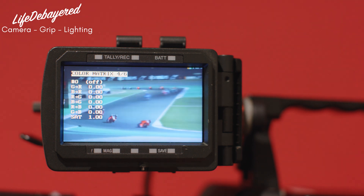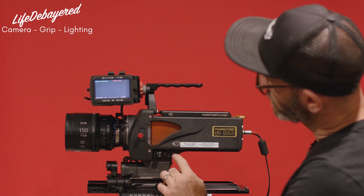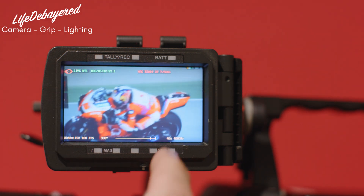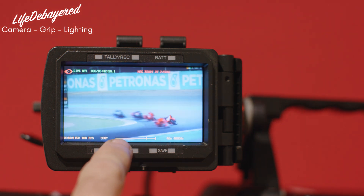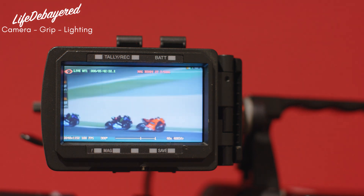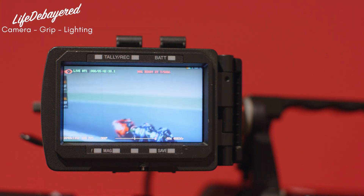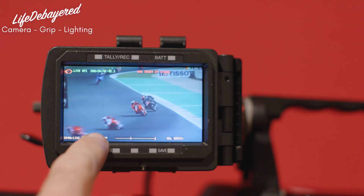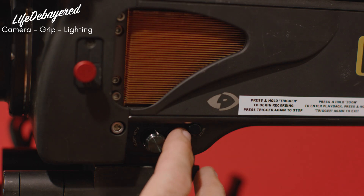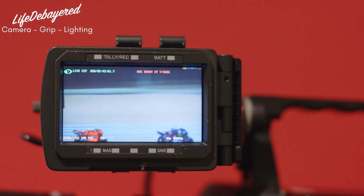You can get through the rest of the menus from here, and to exit you can press the trigger button. To begin recording, press and hold the trigger button until the phantom icon turns red. The volatile RAM is now filling — when it gets to the end, the volatile RAM is full and it will keep overwriting and looping. Now it's set to an end trigger, so when you hit end it will dump everything behind it — everything that's passed for the last 40 seconds or whatever is full. Press the trigger button again to stop recording. The red light will go away and it's now stopped.